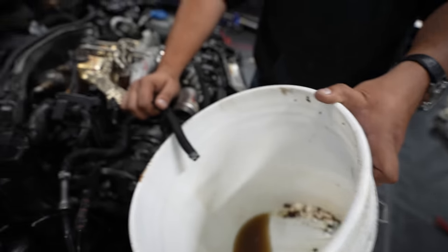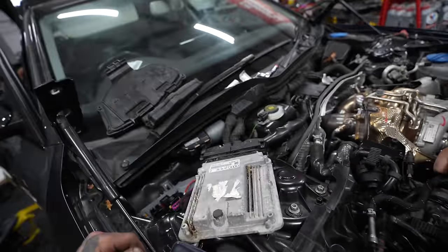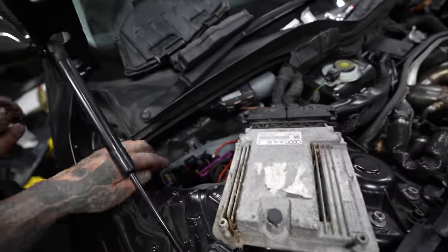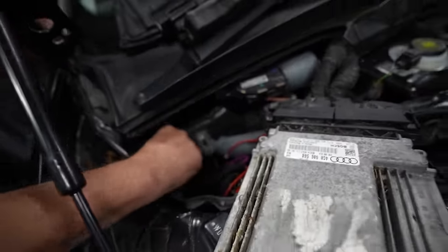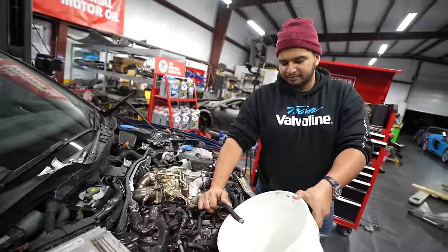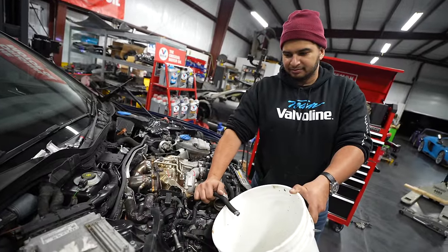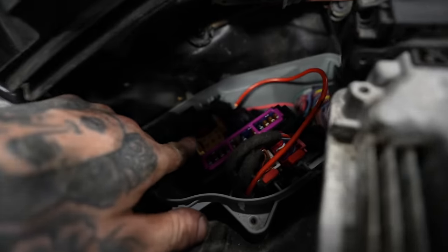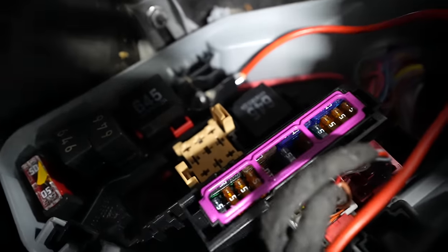When you turn the ignition on, it only primes the fuel pump for a few seconds. So we need to find the fuel relay so we can send power directly to it. And the way we was doing that was just by removing relays and putting the ignition on to see if the fuel pump would prime. And when it didn't, we know we found the right one. Nope. Nothing. No, we found the relay one. So that is the relay, this one here.